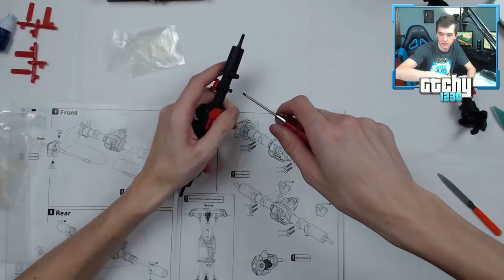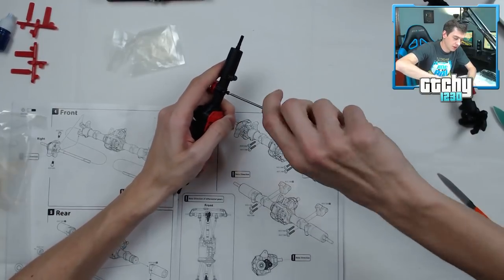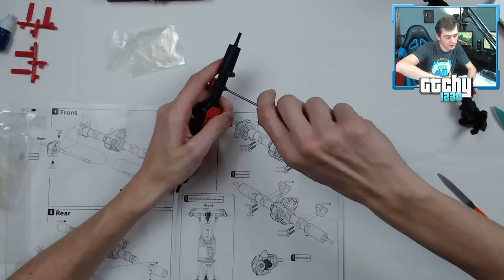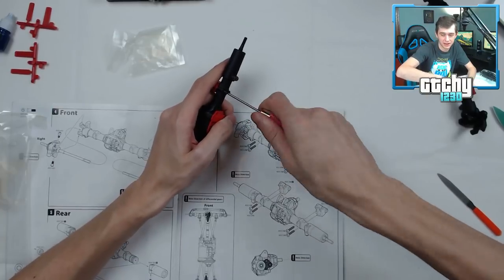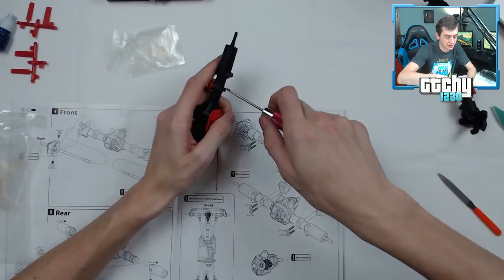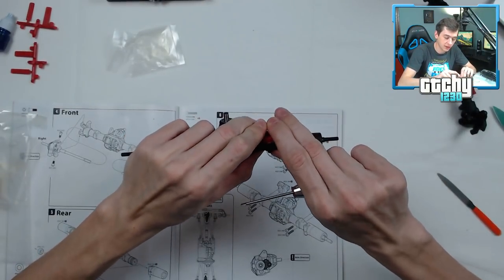You should have gotten a 35-turn brushed motor. Here's why I didn't do that. Brushed motors wear down quicker. They need replaced sooner. I get that they're cheaper and stuff, but they also need more upkeep. You have to clean them more often if you get, say, sediment in them. And then lastly, brushed motors are just slow, which is, again, usually fine for a crawler build.